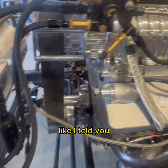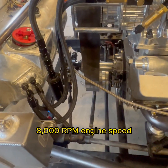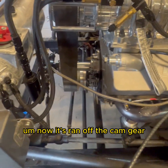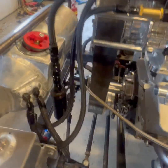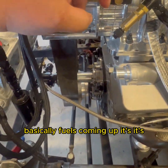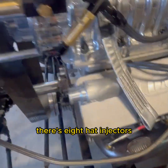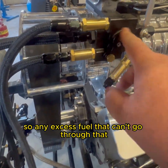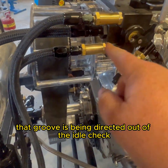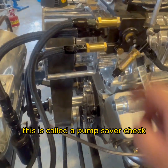All these brass pieces are check valves. There's an idle check valve — the fuel pump will make about 160 PSI at 8,000 RPM engine speed, but since it's driven off the cam gear it's only running at 4,000 RPM pump speed, half of engine speed. At idle, fuel goes only through the barrel valve to the hat injectors through these eight hat injectors. Any excess fuel that can't get through that groove gets directed out of the idle check back to the tank. Then there's the pump saver check — set at 150 PSI — which opens and dumps fuel back to the tank to protect the pump when you snap the throttle shut at the end of a pass.